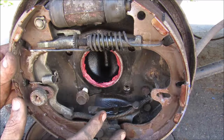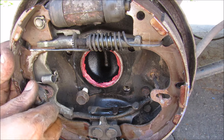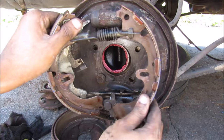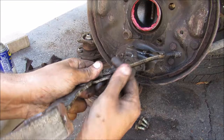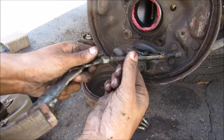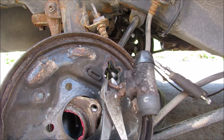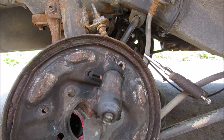To get a better look I'm going to disassemble these drum brakes. I'll start by removing the guide pins. With the spring free from the bottom I can go ahead and remove the shoes. Then I'll pull back this spring and release the parking brake cable from the shoe assembly. Now I'm going to remove the brake line.